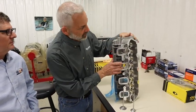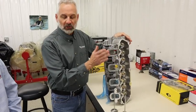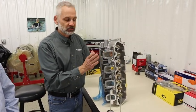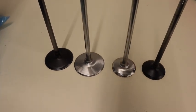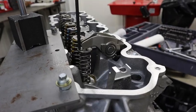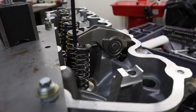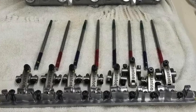This is a stage two, and I'll talk about the stage one, two, and three as I'm going through so people can kind of understand the difference. As with any cylinder head, CNC porting of the intake, the exhaust, and valve sizes are all very crucial. This stage two still utilizes the stock rocker arm system, as opposed to the stage three, which we have machined off and have a shaft-mounted rocker system to go with that.